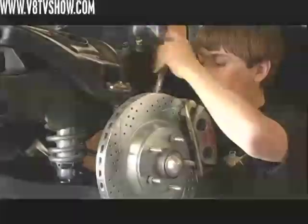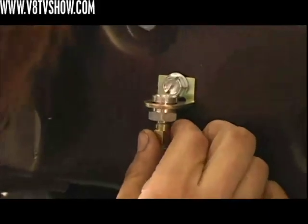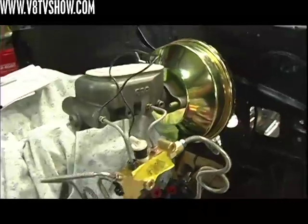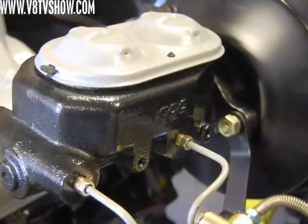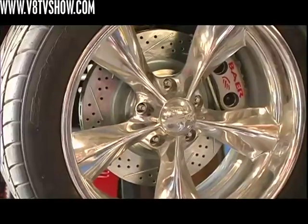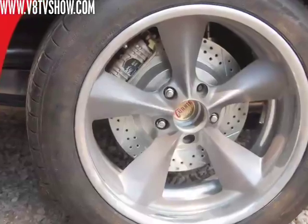Run those bolts down tight, then you can turn the whole assembly and run the hoses into your existing brake lines — or in our case, all new brake lines supplied from a kit from Classic Industries. We ended up replacing all of the hard lines on this car with a stainless kit and did some detail work like powder coating the master cylinder so it looked nice and didn't rust. One note: these front brakes from Baer require at least a 17-inch wheel for clearance. We actually had to shave our calipers just a hair to get the wheel to fit, but once it was all together, a quick brake bleed gave us a wicked set of brakes — this car will stop as good as it goes.